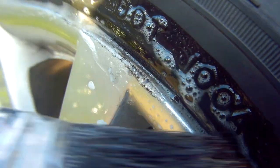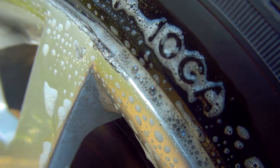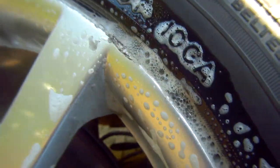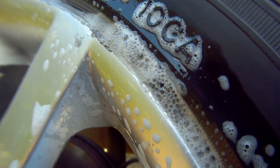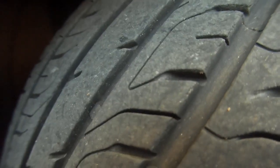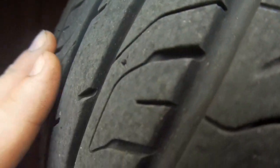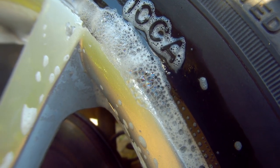So to fix this, you need to get the shop to sand over the corroded areas until smooth, and then use a sealant, which should fix the issue. If it's leaking from the valve, then you'll have to get a new valve fitted. If it's not leaking from the front edge, then you'll have to move over to the tread surface and the rear of the tyre, but you'll have to take the wheel off for that. Although more often, it is the front bead edge, the valve, or the tread surface.